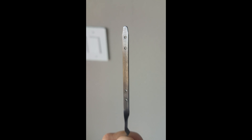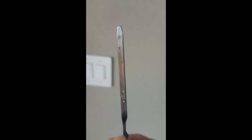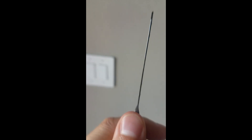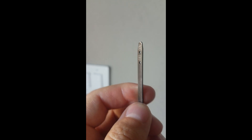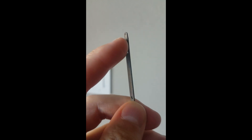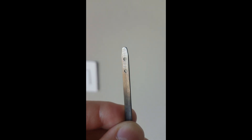One of the last things I did during this service was modifying the dipstick. I read about cases where the dipstick tip wears the inside of the transmission pan over many miles and eventually starts leaking oil. So I took a very small amount off the tip — just about a fingernail's worth — on my other dipstick. That should give it enough clearance and it won't affect your ability to properly measure fluid level. Not many cases out there, but it has happened, so it's worth looking into.